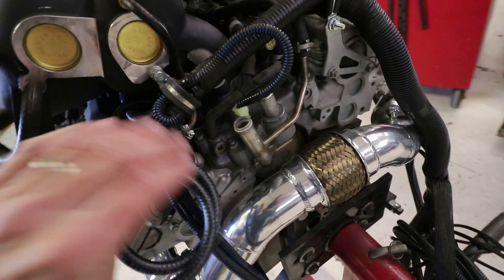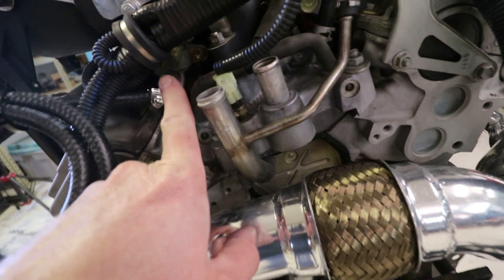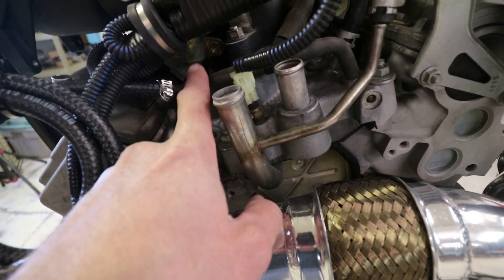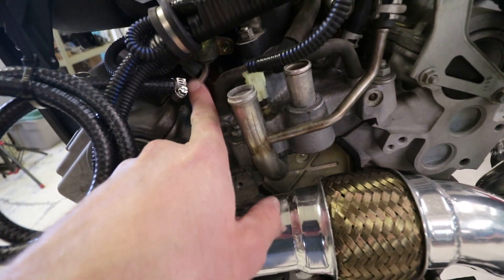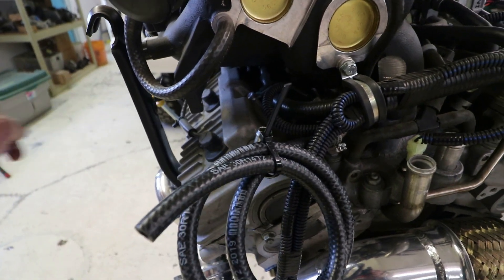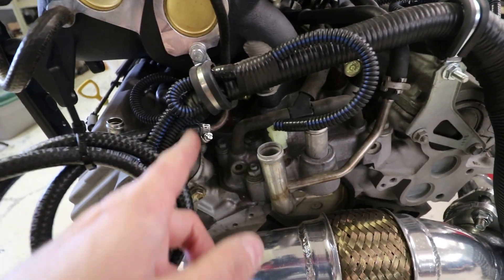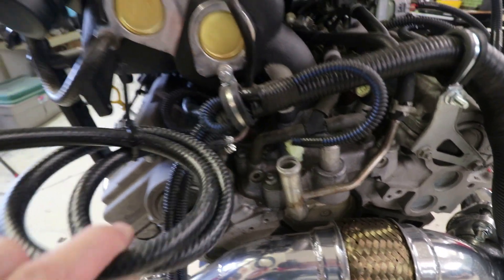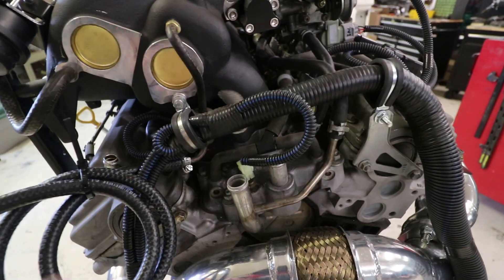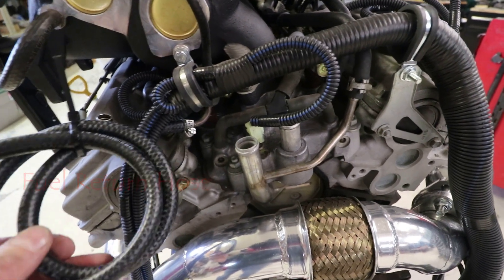Moving toward the rear of the engine, this coiled-up hose right here is clamped to the bottom of the fuel pressure regulator. The fuel return hose comes off of there — on a factory setup it would come around and exit to the left-hand driver side of the truck, but we bring it over to the right-hand side. We simply pull the pipe off the side of the engine and put a hose straight to the fuel pressure regulator, bringing it up along the top of the firewall to the return line on the right-hand side.